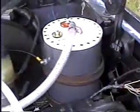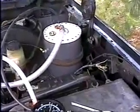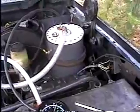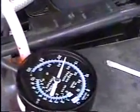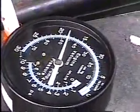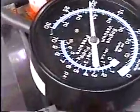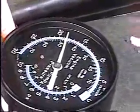That's the cell — that's what it looks like. It's made of PVC half-inch thick Schedule 80 plastic for the cylinder. The top and bottom is polypropylene or ethylene plastic, and it's been drilled with 24 bolts in the top, 24 in the bottom, at 15-degree intervals. As the engine runs, you can see the actual vacuum has moved up to 18 inches from 17. This engine has 174,700-plus miles, and it runs beautifully. We're using old technology with a newfangled idea, and it definitely works. I'll post more on this later as time progresses.